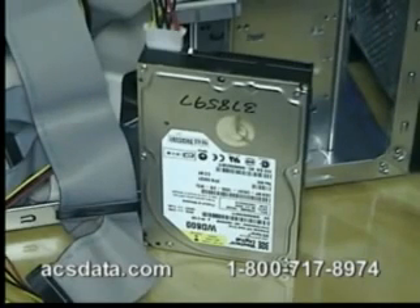You hear that steady clicking. What these drives will typically do is they'll power down, spin down just a little bit after a few clicks, and then spin back up and start clicking again. I'll go ahead and power that off. That's pretty common with Western Digital hard drives.